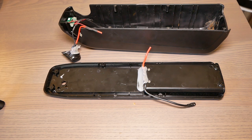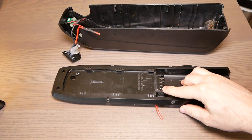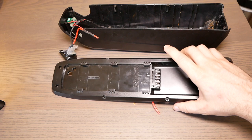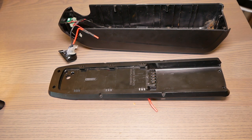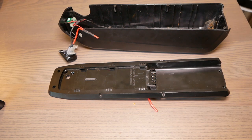What we have here is a shark pack, and on the underside we have an issue with these terminals — the discharge contacts between the case and the cradle. This is on the case itself. There are a couple different things you can do here if you don't have the replacement cradle or the replacement module for swapping out these contacts. They can get burnt up or maybe there's a high resistance connection.